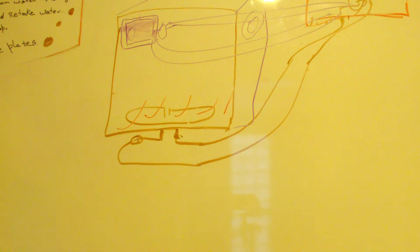We know that we're using the turbidity sensor to find out when the water is dirty. Drain the water and take in new water. We know how that is done. We just spoke about how the soap dispenser drops the soap, and then we can continue running. The rinsing cycle is nothing but draining the water that had the soap, putting in new water, running the circulation pump to clean, and then draining that water.